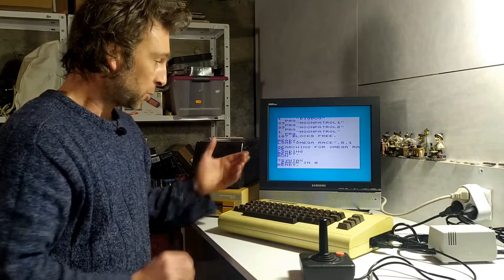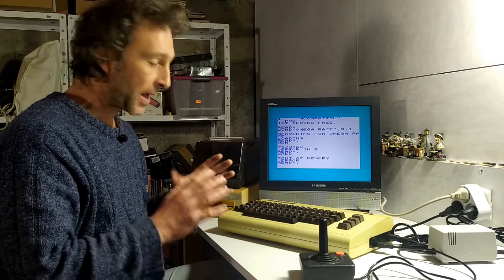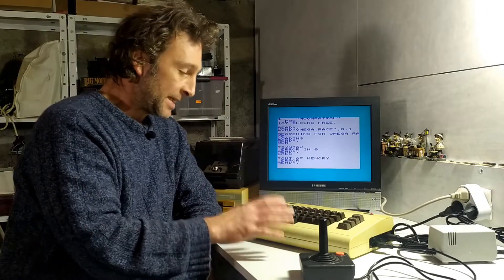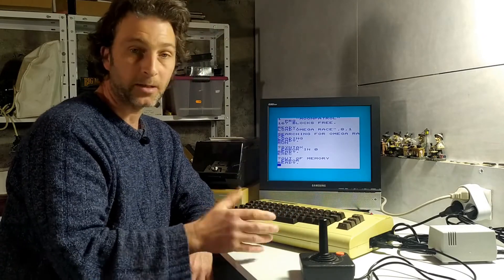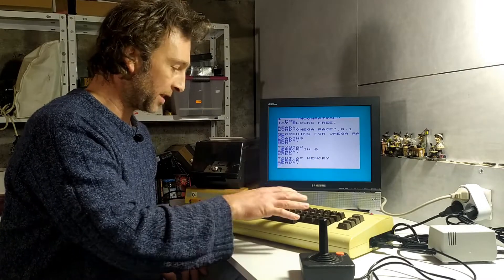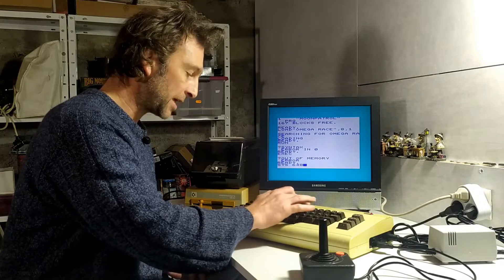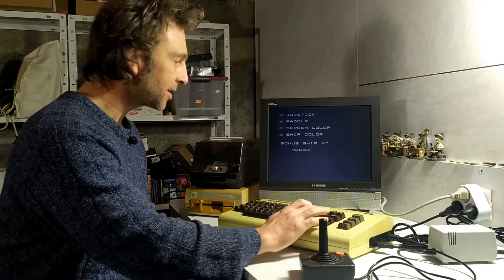Once it's loaded, if you type RUN like you would with a BASIC program you get a syntax error, and EXECUTE gives an error as well. Generally speaking, a cartridge is inserted when the computer is off and powering on makes it work, so you need to power cycle the system. However, power cycling will wipe the memory in the expansion card, so you'd end up with no game. What you can do instead is install a reset switch, but there's actually no need — there's a system command, SYS64802, and when you press return it does a warm reset on the VIC and starts up the cartridge.